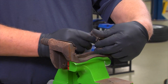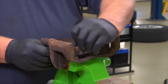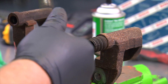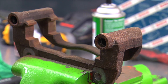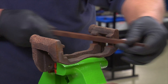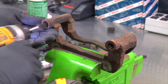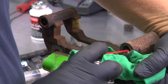Mount the bracket in a vise. Begin the bracket service by stripping the bracket of all hardware. Note which pin came out of which bore — there may be a dampening bushing on the end of one of the pins. Use a file, roll lock disk, or wire brush to clean the area of the bracket where the abutment clip rests. Use a metal bore brush to clean the slide pin bore. When these procedures have been completed, spray the entire bracket with brake cleaner.